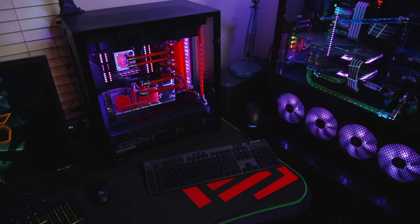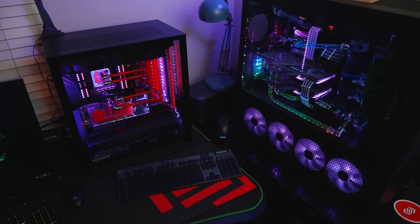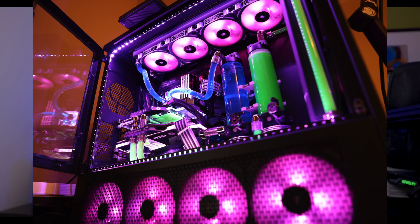I hope you enjoyed this little video — just wanted to show you guys some things not to do. This build is waiting for the 3090. As soon as that's released and I can get a water block for it, that's what's going in. For now, I couldn't really stand to look at that crazy loop, so I cleaned it up a little using soft tube so I can pull stuff out and upgrade it more easily since I'm using it as a test system. When the 3090 releases and I get a water block on it, I'm going to take my time and do as beautiful a job as possible with nice hard tubes — bend the tubes, make it really aesthetically pleasing and very, very nice. Until then, this soft tube setup is my test bench.